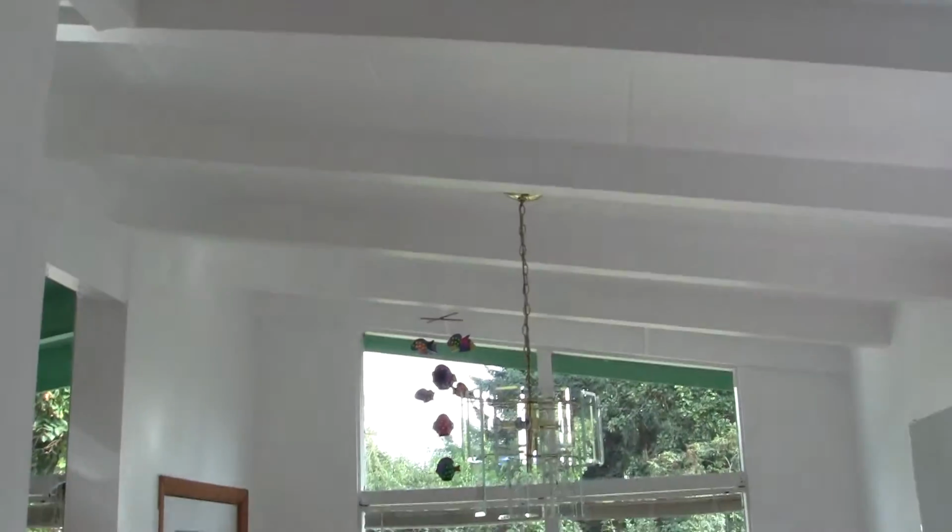And then you can see there's a panel right back there, right where those 2 knots are, and that was taken off to do some work. And I'll take some caulk and I'll caulk that line all the way in, right down to there where you see the black lines, and all the way down to the bottom and across, and repaint it, and it will look like one piece again. But these are just a few of the tricks that can really make your paint job stand out. It's not that hard to do.